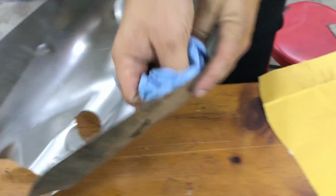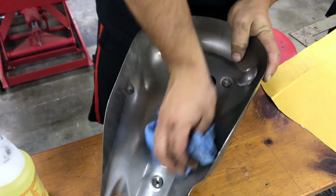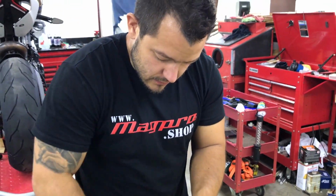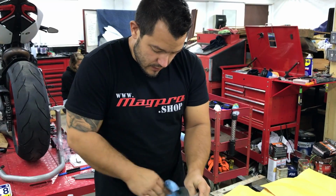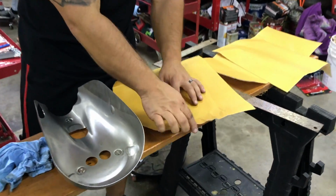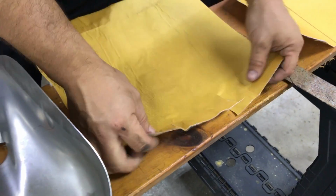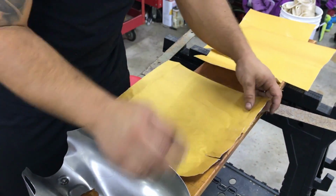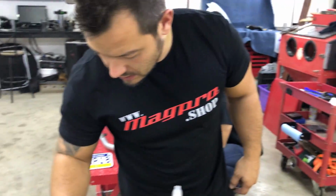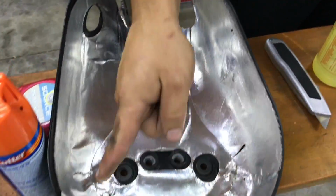So we just cut a big piece of heat shielding here. We're cleaning up the surface right now. And then you're going to start laying it in there, Dado? Yeah, I'm going to get the heat gun out and try to get everything positioned. I already made 2 cuts right here because these are going to have to fold in like that. For the side, I'll probably have to piece one in. From factory they did a center piece, 2 side pieces, and then the top. The fewer cuts you have, the better.